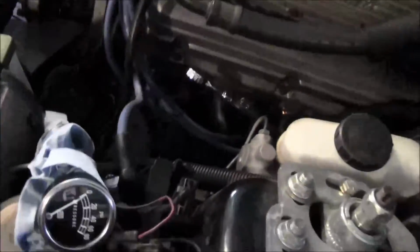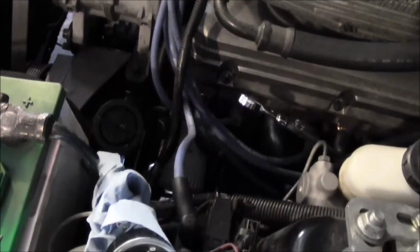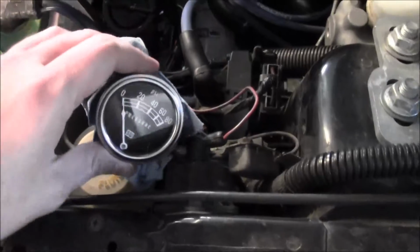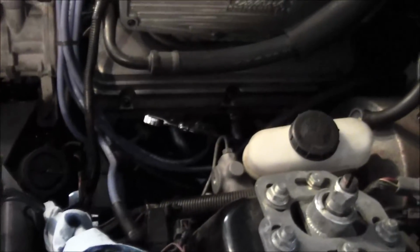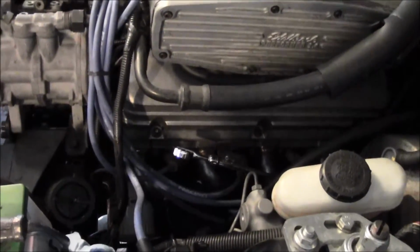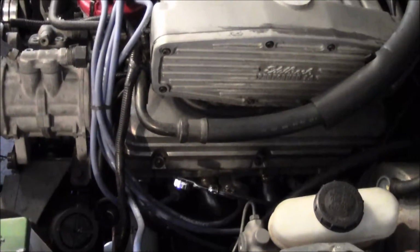So I ended up going to get a gauge because I thought, well, I don't know what's going on with these gauges. Maybe the gauges in the car are not right for whatever reason. I don't have my dash light, so I don't know what's going on with the electrical in this car. So I went and got this gauge, and I wasn't even getting 20 psi on this gauge. So I'm like, did I get a bad gauge? I mean, the bottom end's making some noise, no doubt. The car's gonna need a motor. That's pretty well established, but I like to drive it, even with a rod knock. Just get it out there and enjoy it a little bit before I go tearing the motor out of here.